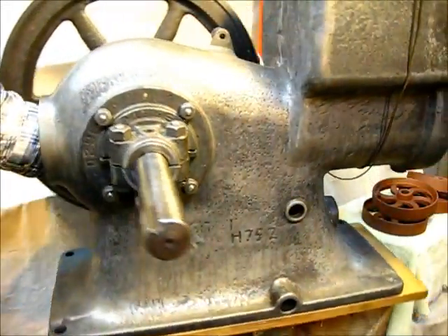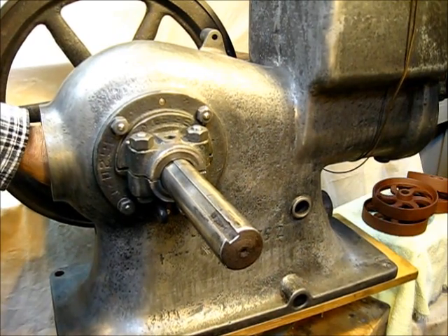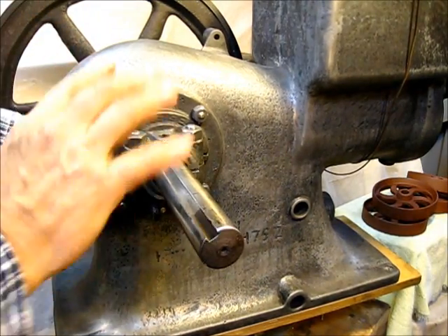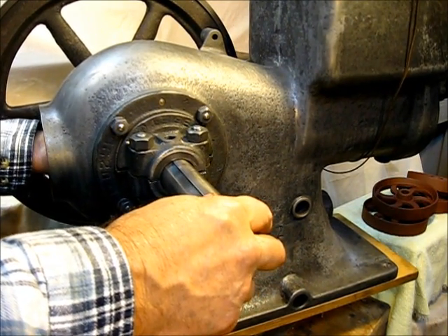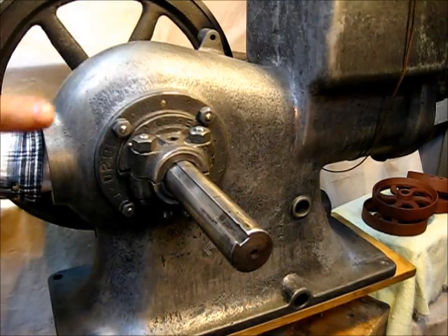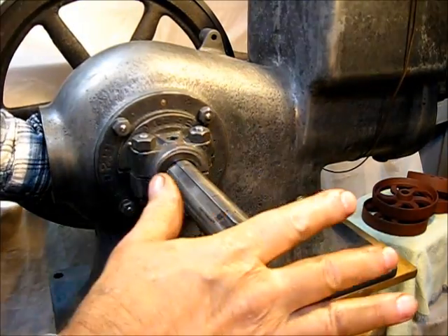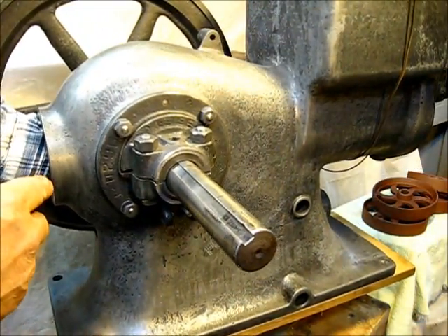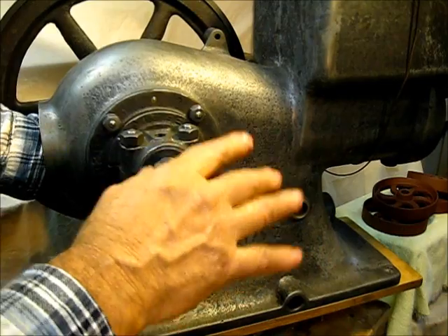I felt it fit up to the crankshaft. All the time you have to make sure that the shims are turned the correct way. It's kind of one of those feel-as-you-go things. The easiest way to do that is to drive the piston backwards while you are holding the rod to the throw on the crankshaft.